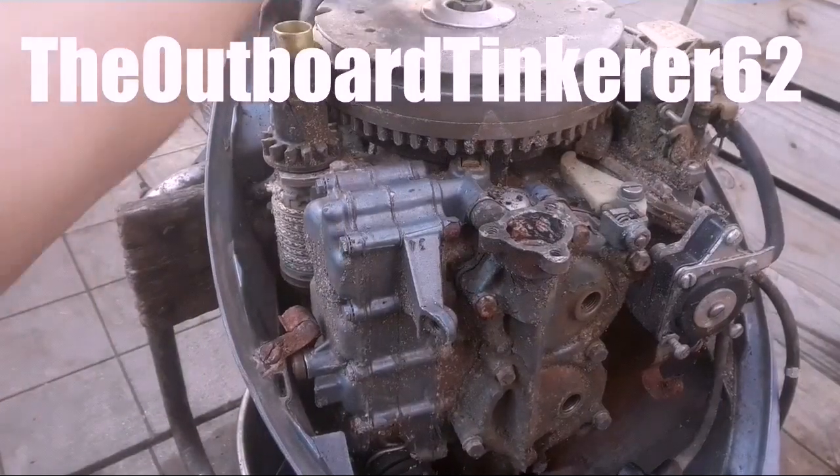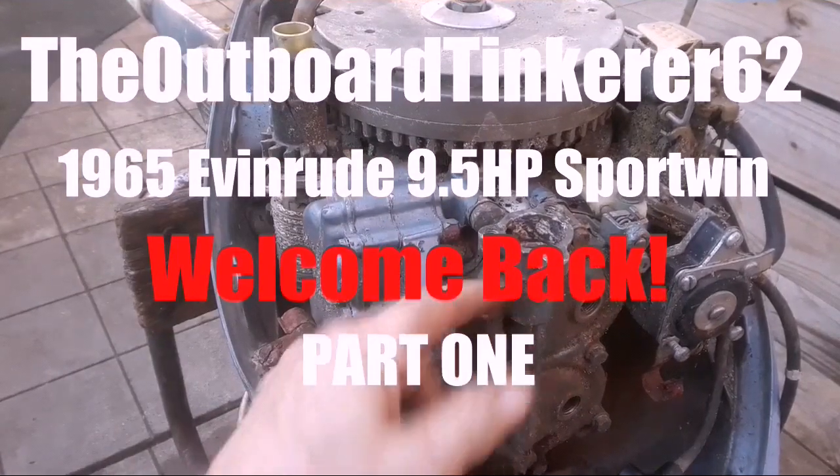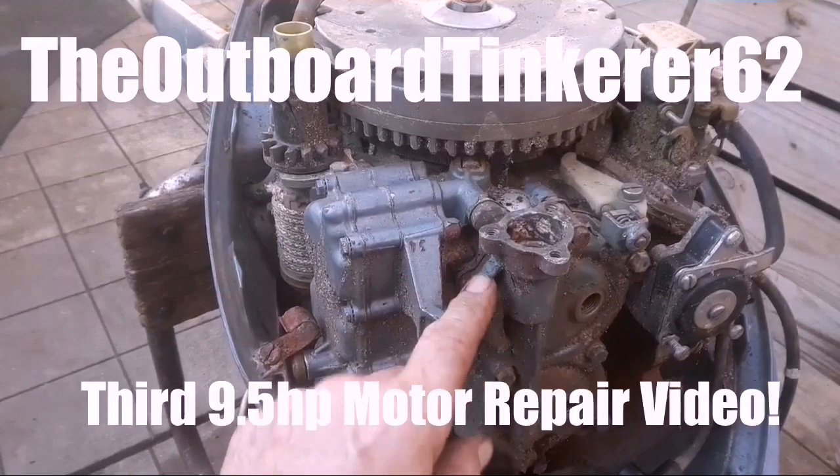So what I did first, before I pull the head — I just like to do it this way — get the fuel out of the way, because I'll be using a torch in this area for long periods of time. Back to my 10 minutes on each bolt if I have to. I hate breaking bolts.